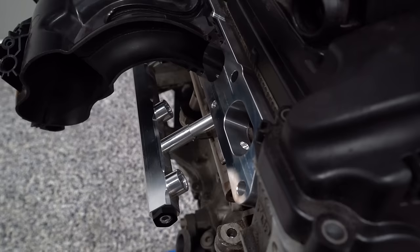Colder air intakes — the factory intake had major engineering behind it. We have our velocity stack intake with an open filter, but if you keep your engine with the stock head that revs to seven grand and a stock intake manifold trying to make 350 wheel horsepower, you don't need any fancy intake. A factory intake with a drop-in panel filter will do just as good as any other intake. It was nice to find out that this engine in stock shape — cylinder head in stock shape — flows a lot better on both the intake and the exhaust side. The bad part is in the combustion chamber.